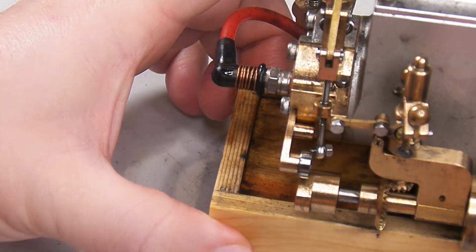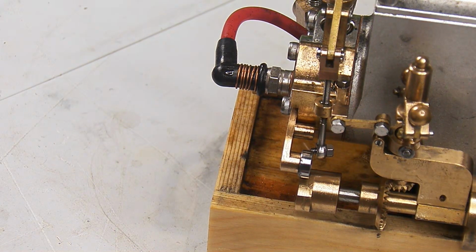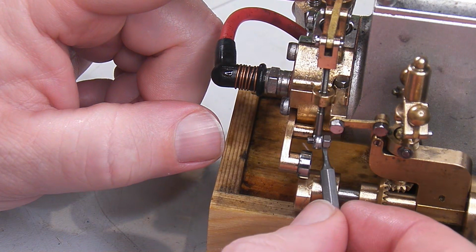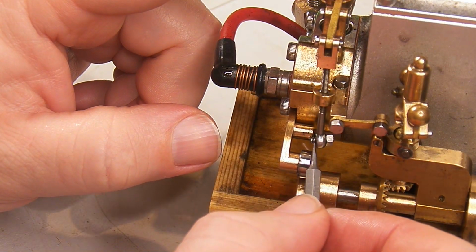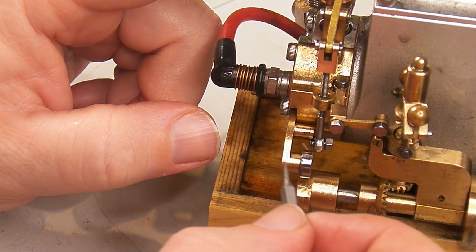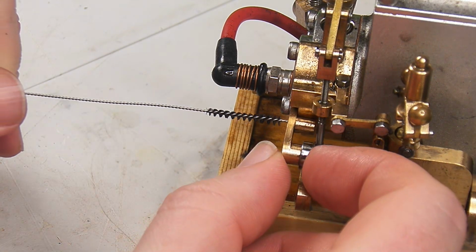Alright, so the ET7 here, or 6, it stopped, and was almost out of fuel, but the reason it stopped is because the nut here that holds this linkage for the exhaust came loose and popped out of the socket here. So I have to get that reattached.